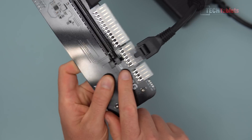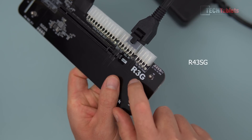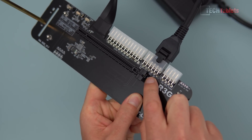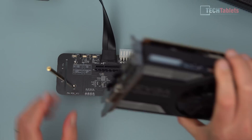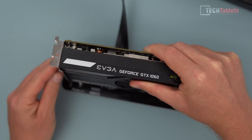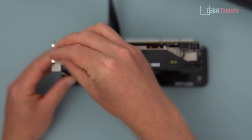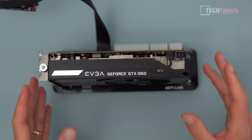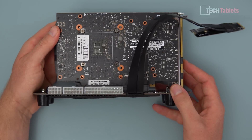The 8-pin connector plugs into the board right here — you can see it states on the motherboard that this is the R43 model, which is linked in the description. Never touch the exposed power contacts once it's plugged in. Installing the GPU is straightforward — just like a desktop motherboard, slot it through the hole, push it down, then tighten the screw. It's nice and solid once secured.